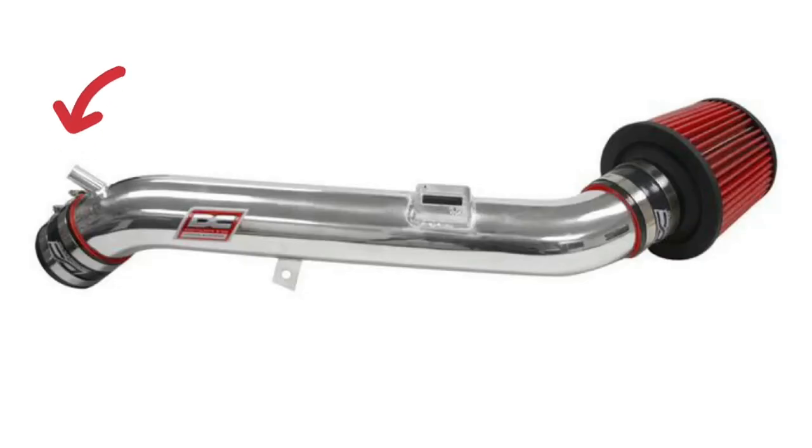As mentioned earlier, the small hose attaches in this area onto the valve cover, and it helps pull out crankcase pressure that traveled up to the cylinder head. And vacuum is created through the Venturi effect, which was discovered by my homie, Giovanni Battista Venturi.